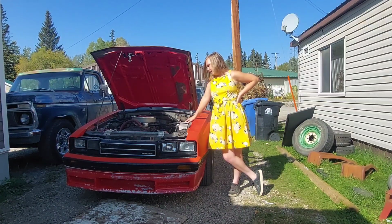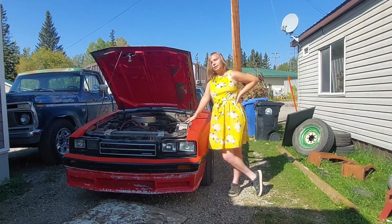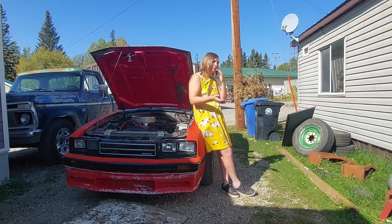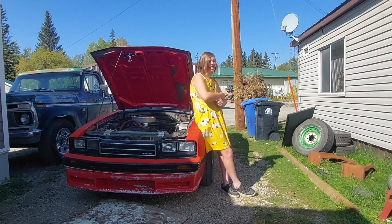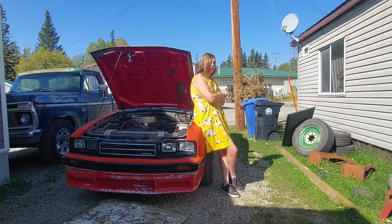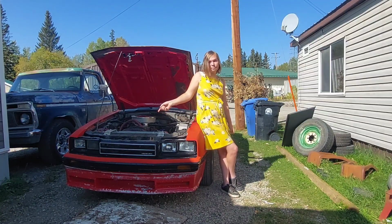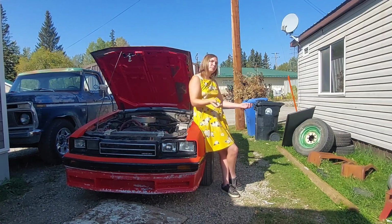Yeah, but I do have good news though. Beyond this, I do have good news. So, do you remember I was talking in my previous video about an engine I could buy? I'll leave a little picture of the engine at the end of the video. The engine has a hole in the block, but it's actually a built motor. Like 30 over pistons, all that different stuff, shaved down head. It's even set up for 3 carburetors. So that head is going to go in here. Plus it's got adjustable rockers apparently. That's cool. And it's only costing me $300.